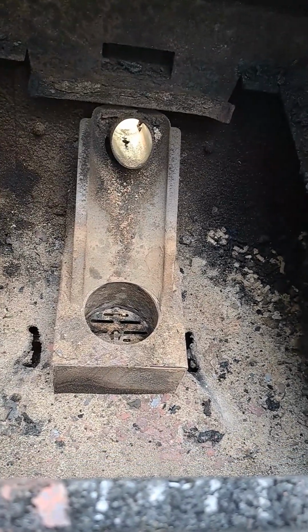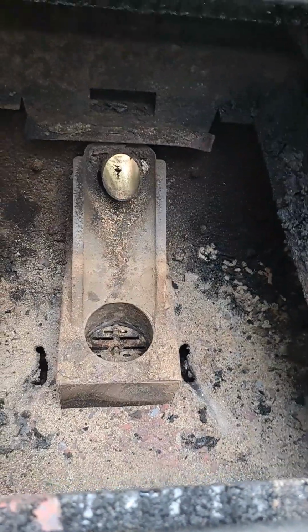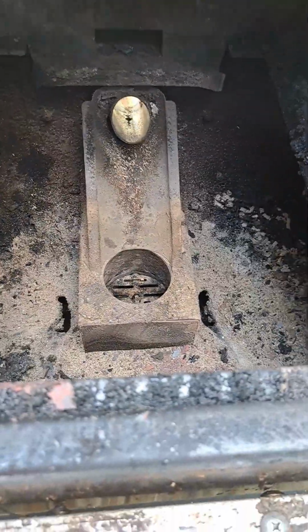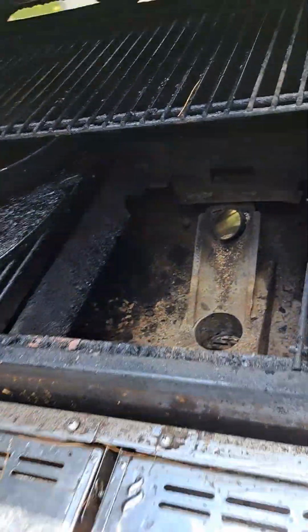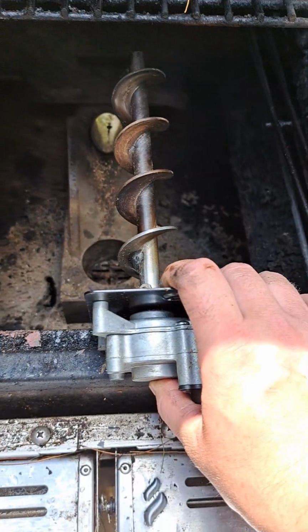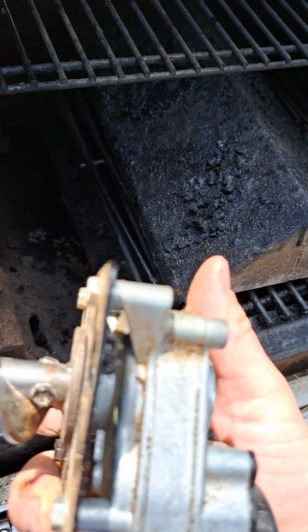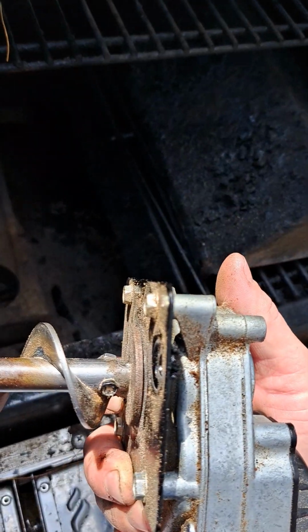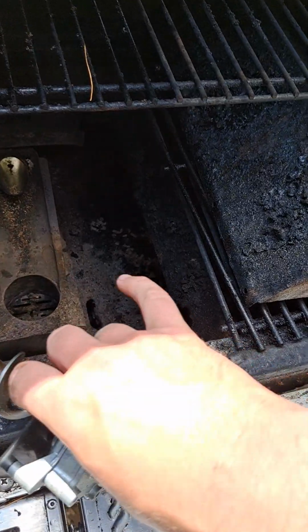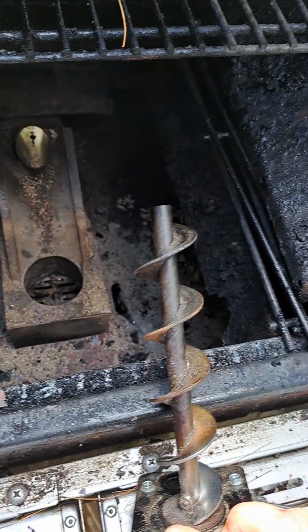So it smothers the igniter, and everybody I talk to at tech support wants me to check, are your pellets wet? I get all these little trivial checks that I know better, common sense stuff. Right now I have the auger out because I've been getting an E5 and E6, a flame-out warning, because it's overfilling with pellets. This is the new design that they made me remove to look at. You'd think they would be able to tell with the revision, or just ask for a serial number to know what it was built with, but I had to pull it out, look, and prove to them that the auger is fine.